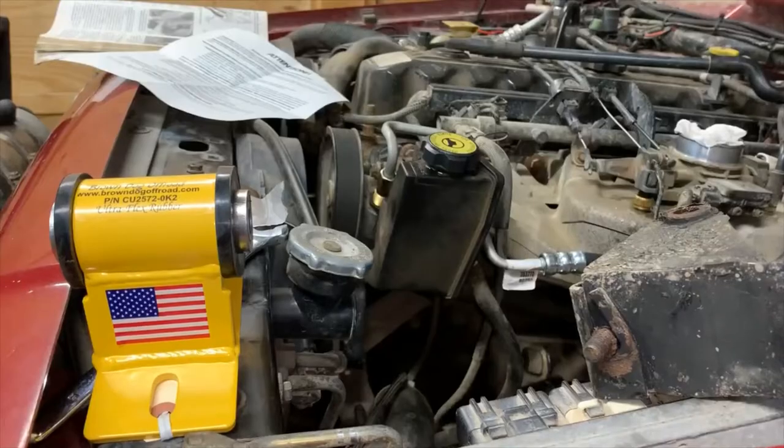Although we changed the downpipe and got rid of that big crush section. It's kind of in a prototype stage, so I'll have to change that more again to get it to tuck a little bit better, but wow. You don't lose torque, but actually, I'll be honest, it feels like you gain torque in the bottom end and power everywhere. I highly recommend if you're going with a header like this and a free flow exhaust that you get rid of that crush section, but you'll likely have to make it out of mandrel bends because most machines aren't capable of making bends as tight as is necessary to do it. So to be continued on that one.